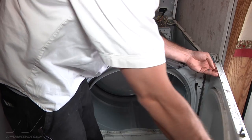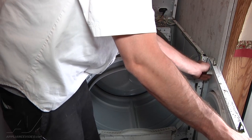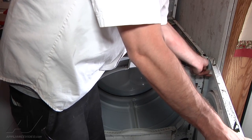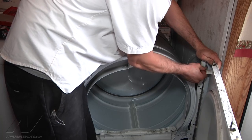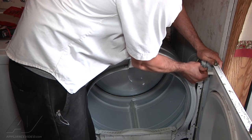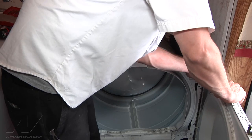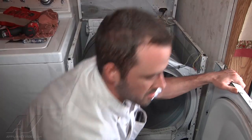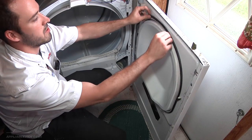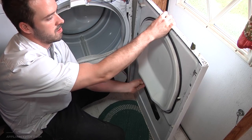You can just swing the front panel right off to the side. It's going to be a little tight, so go ahead and remove the wires that go to your door switch. Make yourself a little note on the order that these wires go — you got white, gray, and yellow. This gasket kind of fell off; you just want to feed it right back up around the door.